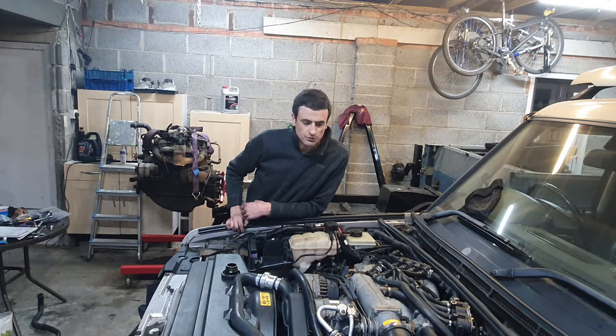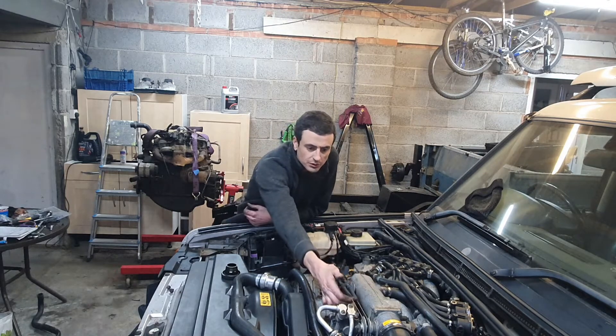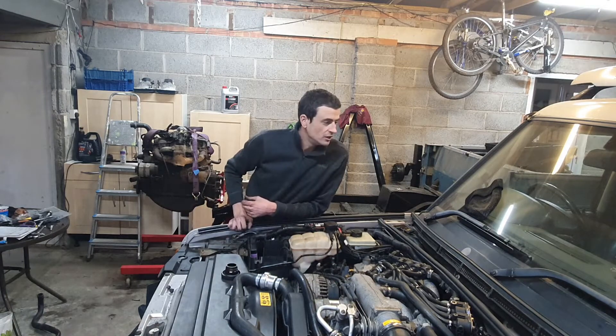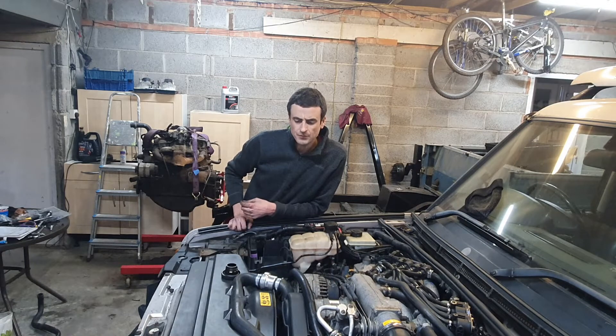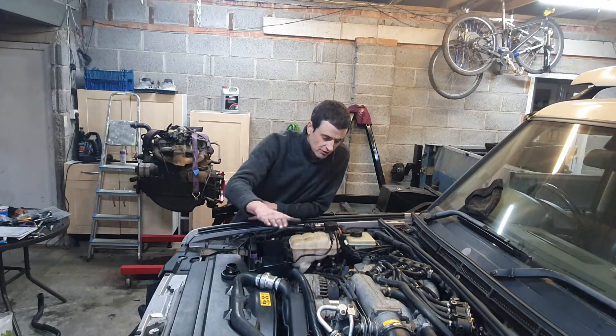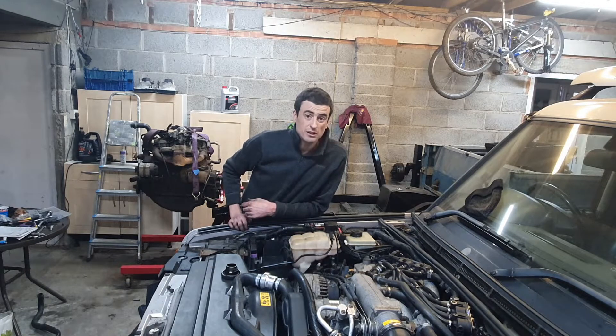Then it'll be a case of running it for a while. I'm going to put something in here — a little bit of wood or something to hold the throttle open — have it at 2500 revs. I'm going to monitor the temperature like mad on the OBD reader, get it up to temperature, check it stays in temperature, the thermostat opens and it steadies off. And then after that, the next time I run it, it really needs to be on the road under some load. All under the advice of my good friend Tom.